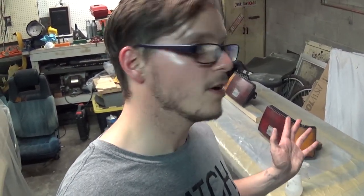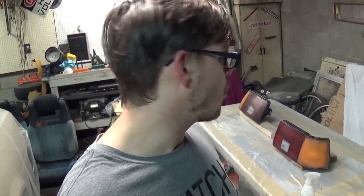Well, sometimes things just don't work out the way you expected them to, and this is a prime example of exactly that. Again, this whole project is, well, pretty much any project that I do is a trial and error sort of project. So stuff that I've never done before, I've got to try certain things, mess up, fix it, you know, and figure out what I'm doing in order for the next time to be a little bit easier. Unfortunately, using the nightshade stuff, man, even just one coat of nightshades is super dark. I don't know if I'm not maybe spraying it up high enough or something, but I can't get the right tinting on these taillights. So basically, I just took 1000 grit, sanded them down. I don't even know if there's any nightshades still on the taillights, but when they're wet, they look pretty good.